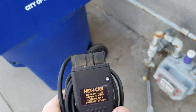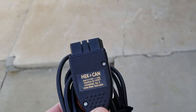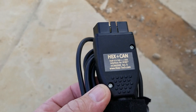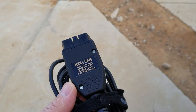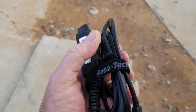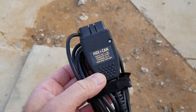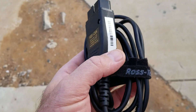There are other ones out there like Auto Ingenuity, but I don't think they actually do the coding — most of them don't. This is probably the only one I know of where you can actually code things like injectors. Some others have limited coding, but they may not do things like that. This one does pretty much everything that VCDS does, which is factory. It's $350, and they have smaller versions with limited VIN numbers, but I wouldn't buy that.